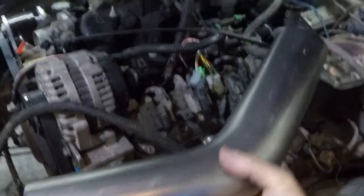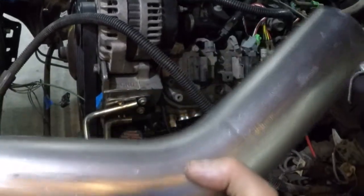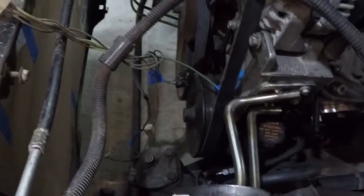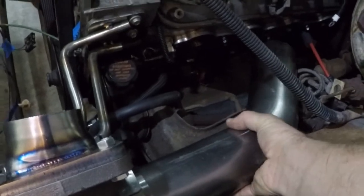What we're going to do is cut this pipe right here and stick it in that V-band and tack it up. It's kind of going up because when this thing compresses — this A-arm — it'd probably bang up against it, and we don't want that. So I'll give it a little sweep upward, then we'll put a little extra angle down on it, and it'll be good. We're still pretty close to that A-arm, not much, but enough that it's concerning.